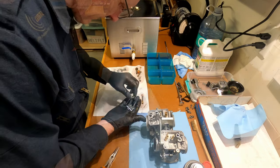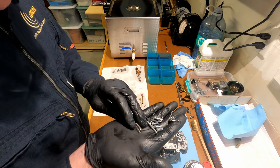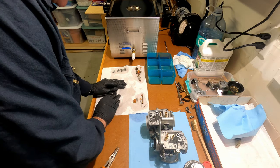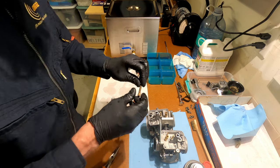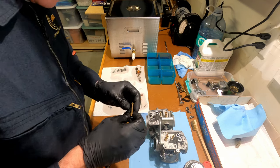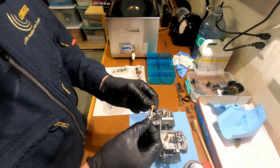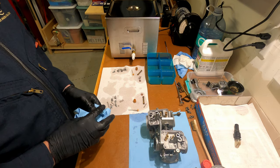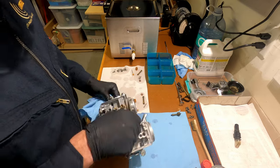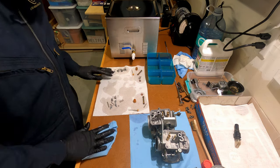The choke is pretty hard to clean — what a difference. These are all the springs — it's the choke spring circuit. All the screws came out really nice, that's the pin for the choke and the clips. Same as the other ones — the main nozzle, also known as the emulsion tube. I'll blow all this out, coat it with a little WD-40, and before assembly I'll blow everything off. Just a very thin layer of oil to keep any moisture from attaching to it, and then I'll start putting the carb kits in.